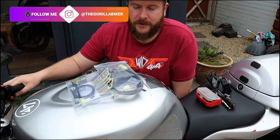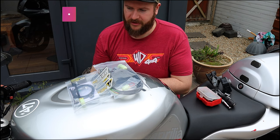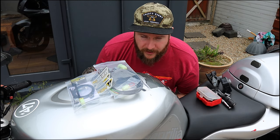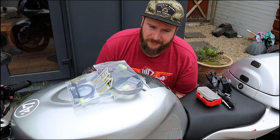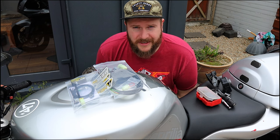So what we're going to do first is take off the seat, lift the tank, prop up the tank — I don't really want to take it off fully. Then we're going to have to take off the air box and throttle bodies, and hopefully that's it. We'll kind of play it by ear. Also Boo is here in the background so you might see her joining the video.